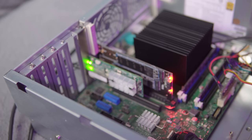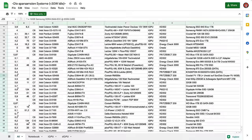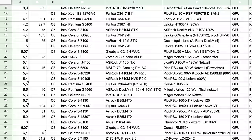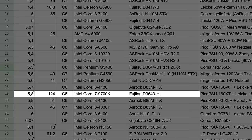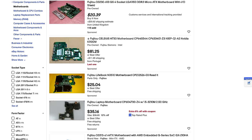But what if you need multiple PCIe slots? I have a 10Gb card and an NVMe adapter that I need to plug into my motherboard, and the ASRock board I used before only had one PCIe slot and no NVMe. Looking again at the spreadsheet, the most power-efficient motherboards — aside from Mini-ATX and ultra-small form factor PCs — are from Fujitsu. This build in particular is very impressive: an Intel Core i7-9700K and a Fujitsu D3643-H combo only pulls 5.8 watts from the wall. I found this D3402 motherboard on eBay, and with 5 SATA slots and 2 full-size PCIe x16 slots, it fit my needs perfectly.